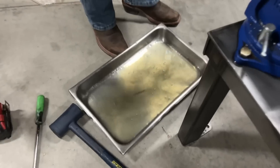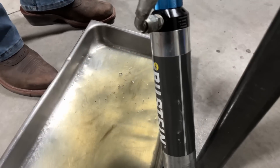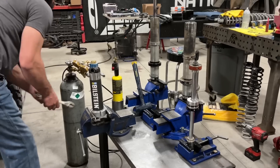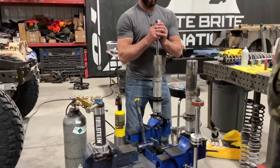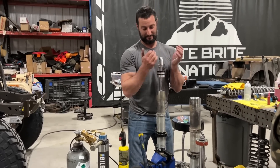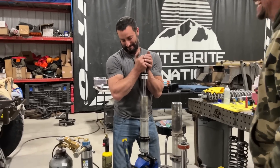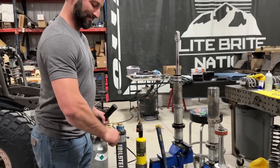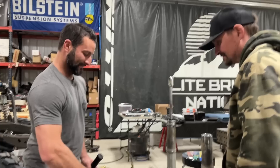It should be just close to running that super wide open - we would only tighten that down if I was going to really boogie. There's not even that much fluid in this whole shock - it should be like a quart or more. Do you guys have nitrogen? Yes. I brought mine. We're going to swap to this red oil - one gallon. So this is not a short process - in your shop, how long does it usually take to do all four? About four hours to rebuild all four. It's like 11 o'clock at night. Phil's on the Jefferson's Ocean whiskey - we're looking for sponsors.